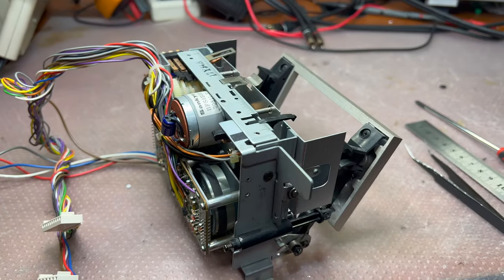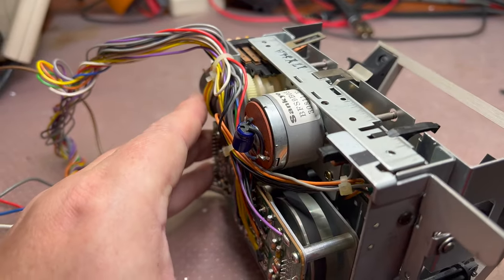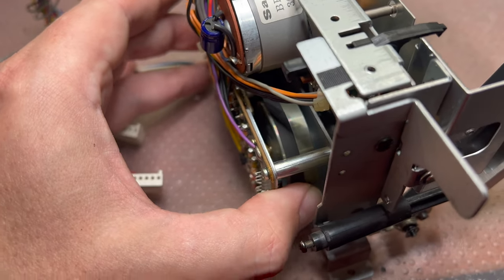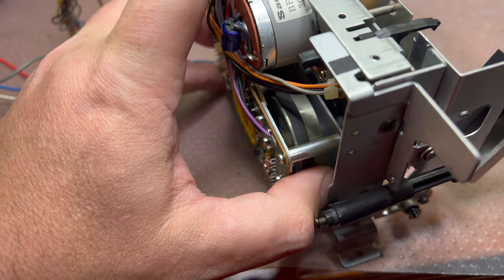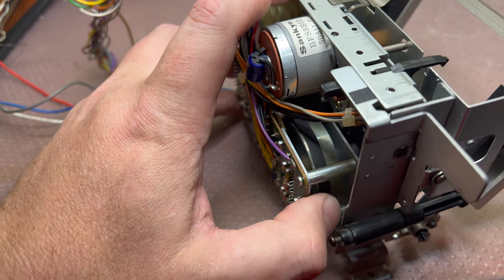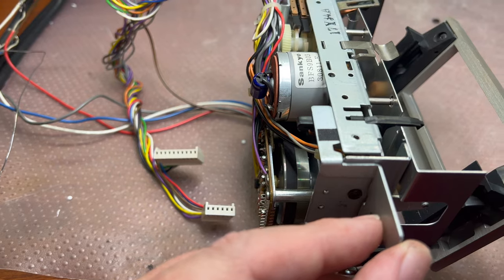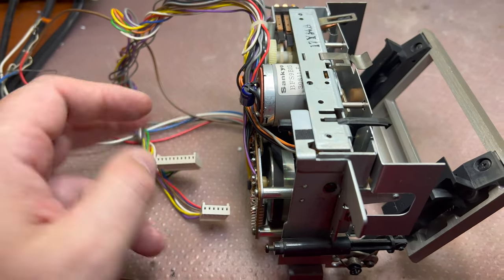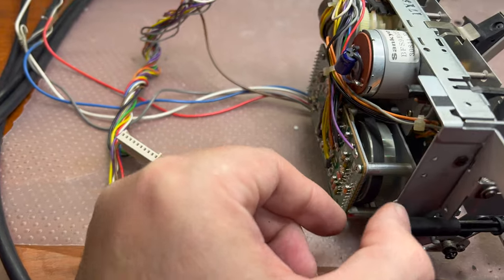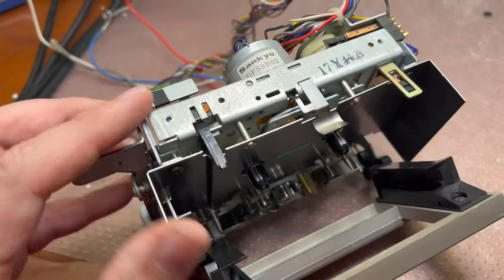I've assembled it back and connected the FG coil — everything runs and the capstan rotates. What I don't like — that's where the savings come in — is that the shift is about two millimeters for the supply side capstan. This will be held by the belt in this position, I believe, but that's it. From the 1990s onward only very expensive decks had those adjustments; this deck doesn't have any adjustments for that.